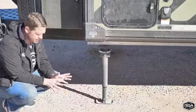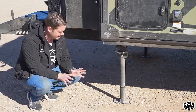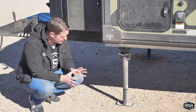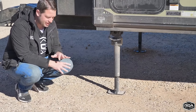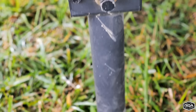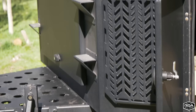Under the same theme, they've also used ARK stabilizer jacks. Normally I tell everyone that stabilizer jacks can't bear weight — just a little pressure to stop the trailer from shaking. But each one of these legs is rated for over 1,900 pounds, for a combined weight capacity of nearly 8,000 pounds.